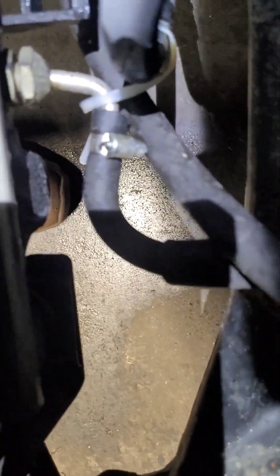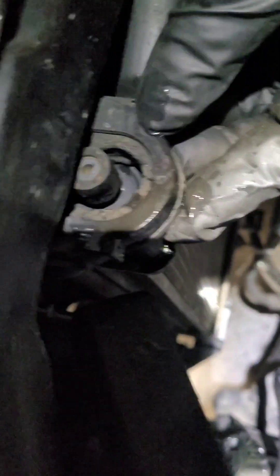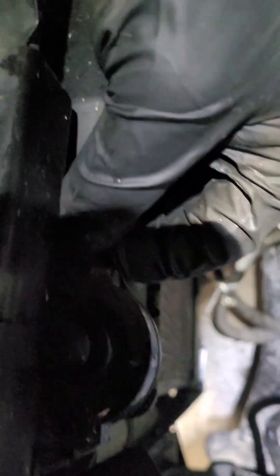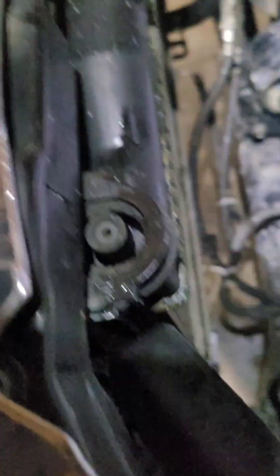That's going to be an 8mm to take out that one. There's a squeeze clip on that one — looks like somebody replaced it with a 7mm hose clamp. So we've got to take that transmission line off. Then go get the hose and these two clips at the top — you just kind of spread these apart. Get a screwdriver and push this side out, then that little clip, get a screwdriver and push that side out, then this pulls forward.